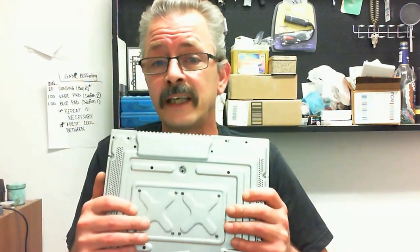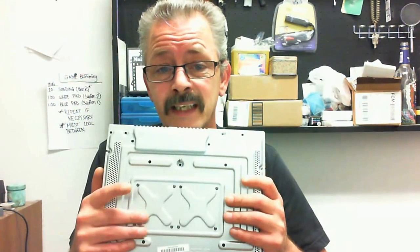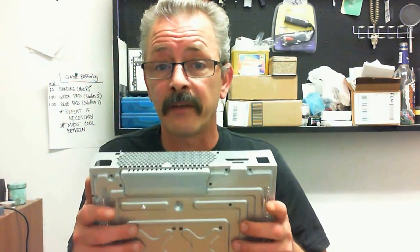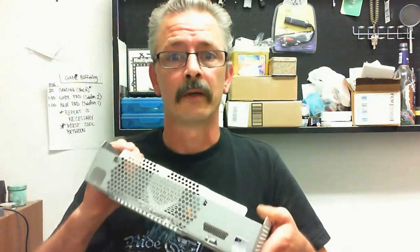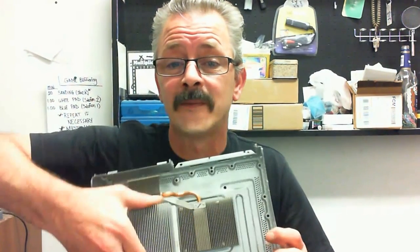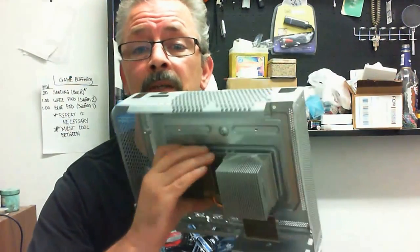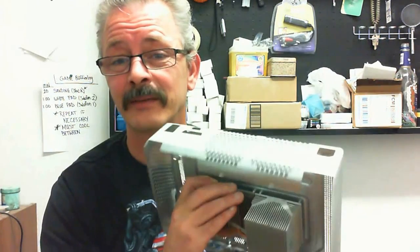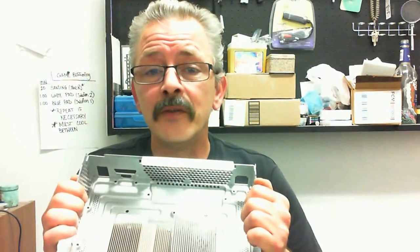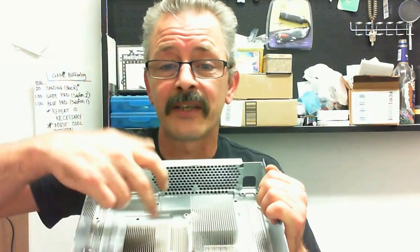When the X clamps are in place and the Xbox 360 motherboard is inside the case, and the T8 screws are tightened down properly, like the manufacturer does, for the most part, the heat sinks themselves are attached to the casing of the box. Not to the motherboard and not to the X-clamps. They don't wiggle, they don't move, they don't slide side to side. Okay. The X-clamps have nothing to do with this heat sink